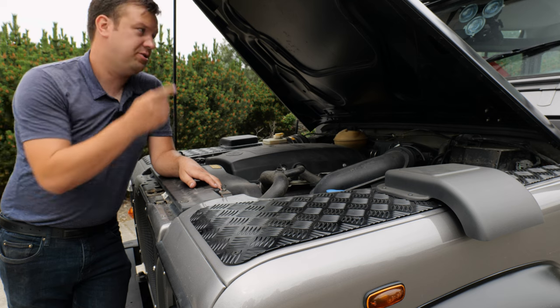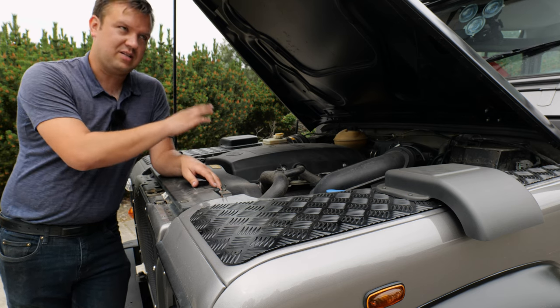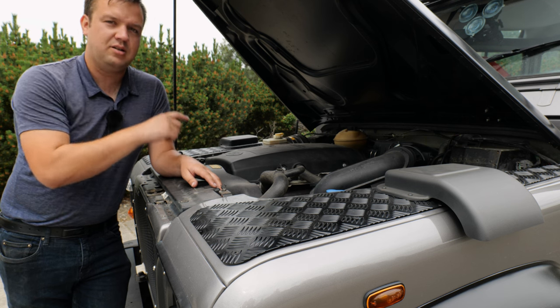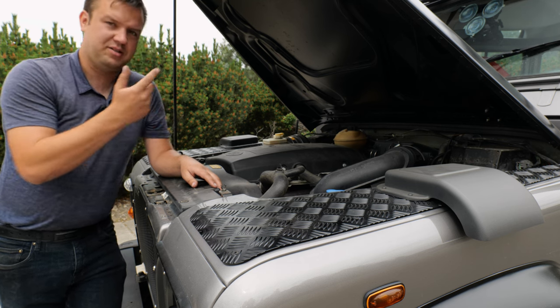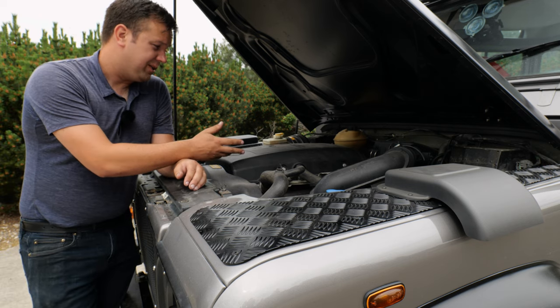But what you have to do is take that seat off, and this might sound extreme, but if it's idling rough, you really want to take that seat off and check the plug to the ECU to see if it has oil coming out of it, because your ECU might be full of oil. Strange statement to say, but it's a TD5 thing. Other than the fuel pressure regulator and that injector harness problem, they're really quite robust engines.